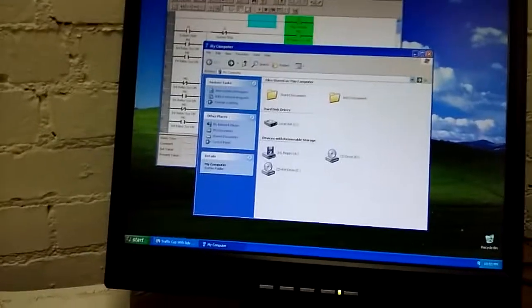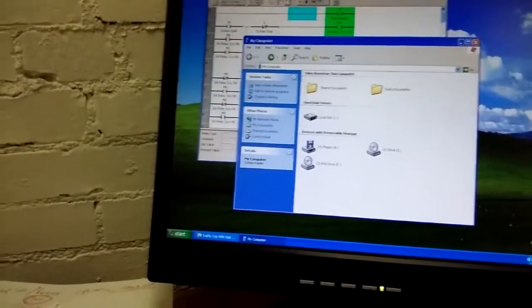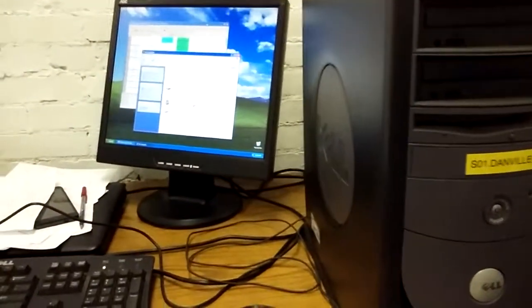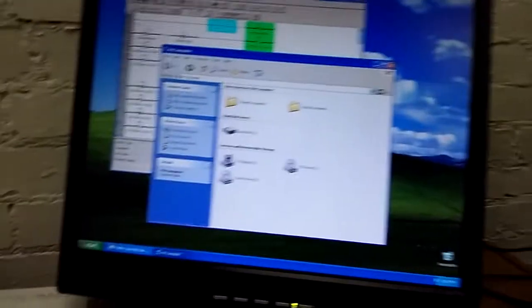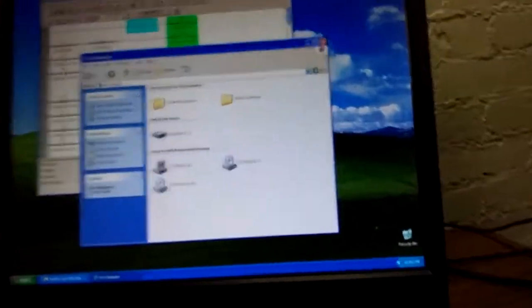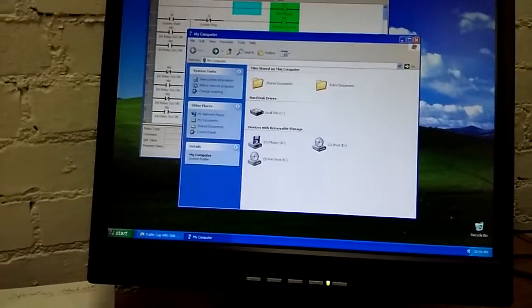Here's the program - I got it done and it's pretty condensed. I took an old Dell computer and uploaded the program to it. I actually installed a brand new copy of Windows XP Professional, and the reason I needed an old computer is because you have to have a serial port - old style COM port, COM 1. It can't be parallel, can't be USB, unless you have a USB to RS-232 adapter, then that will work.